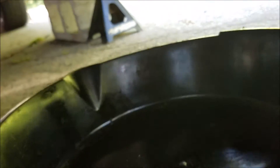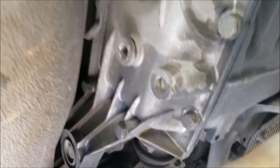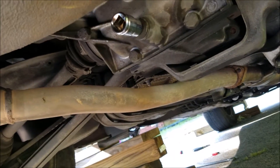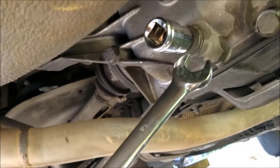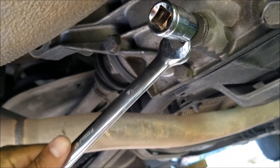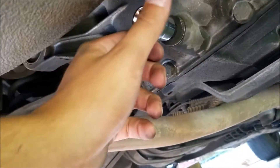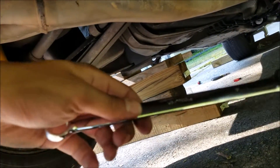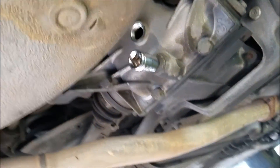It's just a regular black pan that I use for oil. Then I'll go ahead and release the old differential fluid. I'm doing the same thing with this bottom bolt — I got the hex socket on and just put the monkey wrench in it and turn. You've got to put a lot of force on this because it's torqued pretty high, and my monkey wrench isn't that tough in the first place. But it worked for both of these two socket bolts.